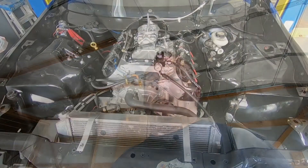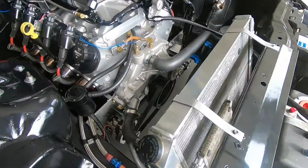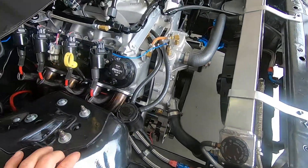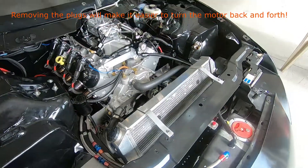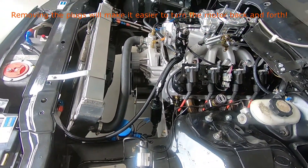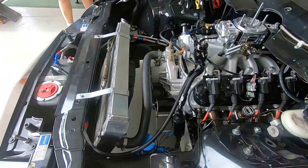I'm gonna have some time-lapse video of moving the plugs, valve covers, and all that — that's an easy process. But I'm gonna have video of how to install a balancer pointer so we can figure out what top dead center is. I'll fabricate some stuff to figure out how to install that pointer, show exactly what I did, how I did it. I'm gonna try to put a timing pointer in there and get our timing mark set right. I have to remove all the spark plugs first.